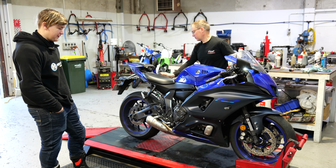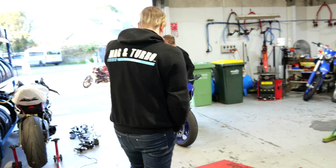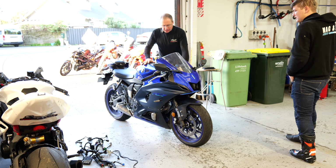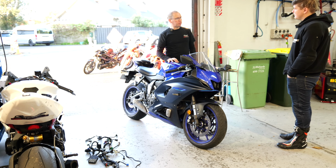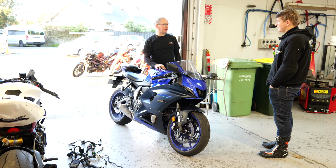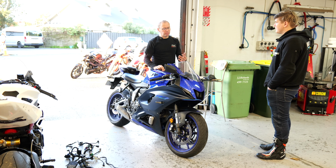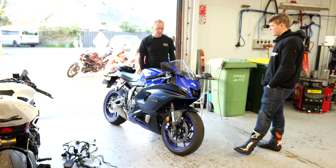But yeah, I think I'll definitely come back and get the fork oil changed. How many Ks on the bike? 5,000? Just a fork oil change. If the bike's a little bit older, say you've done 20,000 Ks, I'd recommend doing a full service, like for seals and everything. People call it a pump and dump. Pump all the oil out of the forks, put new oil in. So an hour's work plus the cost of the oil. Nice and easy. Say $150. And honestly, it will make such a difference to the feel.